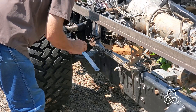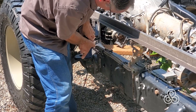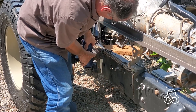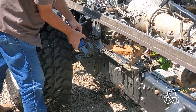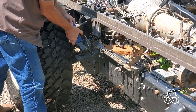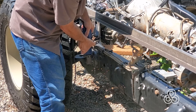Here is the original cab mount in question. As you can see it kind of sticks out there, and while I won't go through articulating the wheel through its full rotations, it does bump into that thing, so we need to trim it off. You can imagine if somebody was trying to put very large tires on this as the original Silverado, it would have been impossible to put 40-inch tires on there, because you certainly could trim out your fenders and quarter panels but you wouldn't want to chop off your chassis mount.